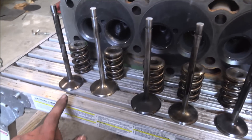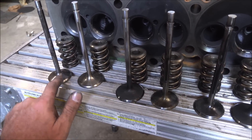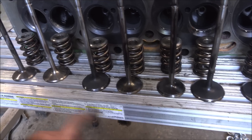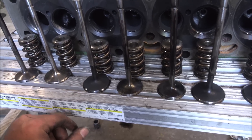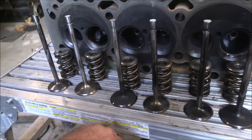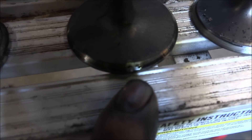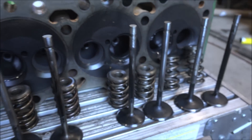Got it all apart. Assuming we've got both a different intake and exhaust on this one cylinder, because neither of these are undercut on the stem like the rest. The face is taller too - a little different profile, probably a different brand. The radius on top is different too. Mix and match. But you can see there are some pretty good pieces embedded in these valves. Let's get that all ground out, get these seats cleaned up, and get this thing back together.